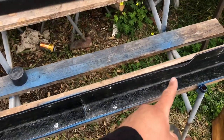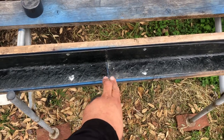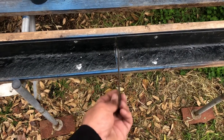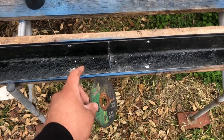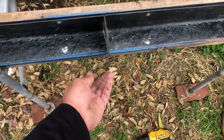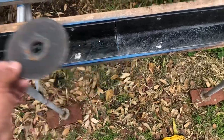Because I already measured these on the vehicle, I made sure to figure out how thick the gap was, because I knew it wasn't going to be as simple as just linking them together and laying fiberglass on top. You need to figure out the dimensions - how thick the material he cut off was. I put the side skirts on the TC, eyeballed it, and it's about as thick as a cutting blade. So I put the cutting blade in between and laid four self-tappers - one here, one here, one there, one there.